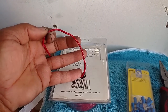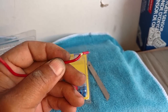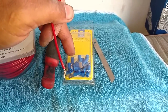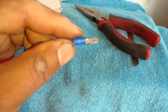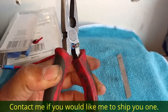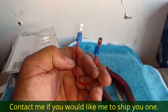Pull off about 5 or 6 inches of wire and cut it off. Take a razor blade or wire stripper and strip off about a quarter of an inch of wire on both ends. Go ahead and pull the end coatings off so you're left with about that much on both ends. Take the connectors and crimp them on the ends of the wire — push the wire into the connector so the tip comes out just a little bit. Pick up your pliers and use the crimping end, squeeze it nice and tight. Now you have a great jump wire that will push into the sockets where the relay plugs in.